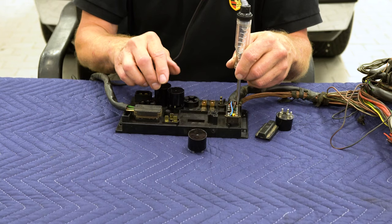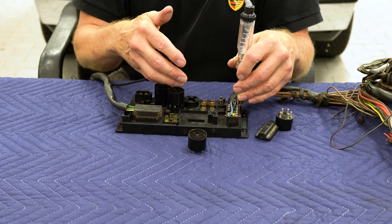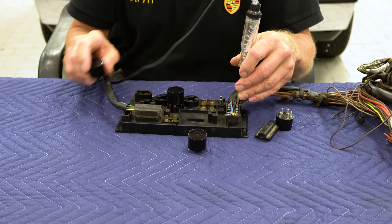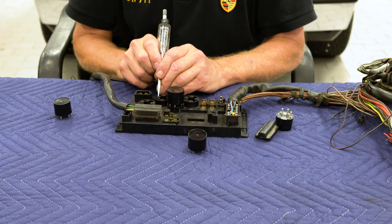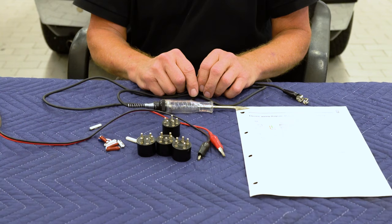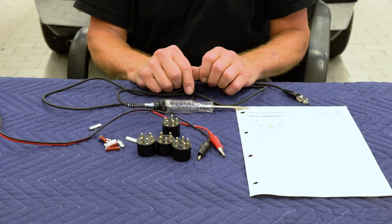By now you should have been able to solve and diagnose your problem and know what's going on. In an extreme case, you can actually jump the fuel pump relay between the two terminals — that will run the fuel pump all the time if you are actually desperate, but I don't advise that because you could cause other complications.